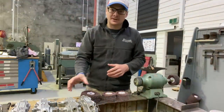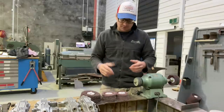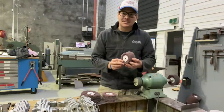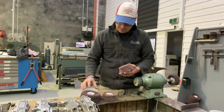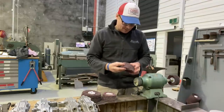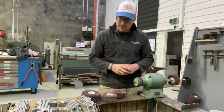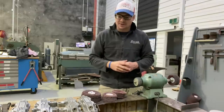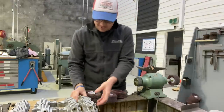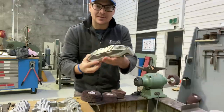We've finished the de-anodizing process — all the caliper pieces are sitting here ready for the next stage, which is our detailing and polishing stage. We use these Scotch-Brite mops — if anyone from 3M is watching, we'd love some free of charge because they get a bit expensive. There are a couple of different strengths: very fine, fine, and a medium coarse. They're little wheels that attach to a bench grinder and we use them to detail up a lot of things — hubs, nuts and bolts, and various parts. We'll run the calipers over the Scotch-Brite mop.